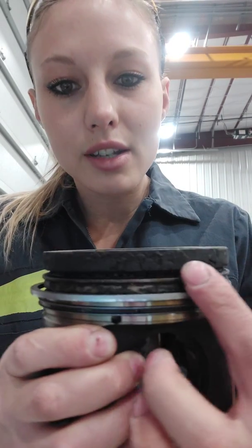Now this is out of a 6090 I rebuilt in an 8310R a couple years ago. As you can see it's got some caking on the piston. This particular engine was burning coolant — that's what that could be from. It also could be from over-fueling, but that's not something you really want to see. That means something isn't burning right in your cylinder.